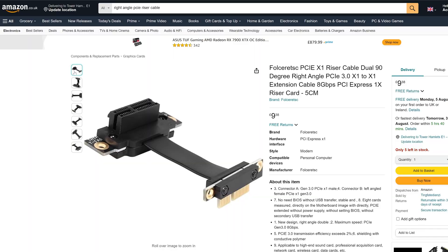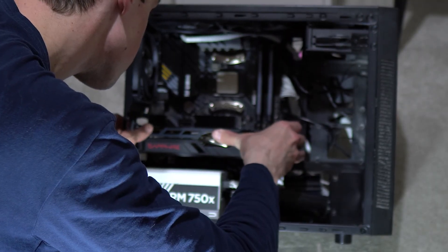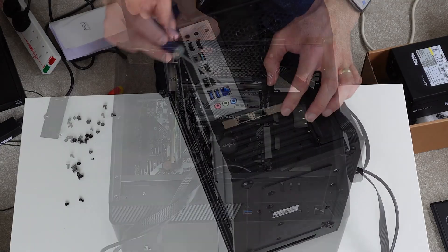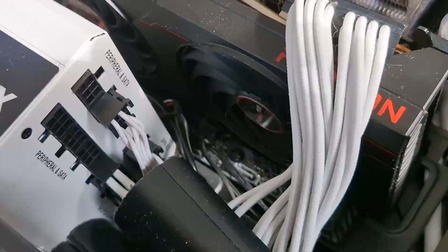If this method doesn't sound right for you, the third thing you could try is — to buy a riser cable. No, I'm not mad, and my teleprompter hasn't crashed. Kidding. Basically, in some cases you can get a slimline riser cable and put it into the covered-up slot before you install your graphics card. This means you can plug your other PCIe device into that cable freely, extending it to another part of your case. Naturally, if the card exposes ports on the back like USB connectors or Ethernet jacks, you have a similar mounting problem. But if it's a PCIe M.2 NVMe adapter, for example, this could work quite well — you just need to make sure your graphics card has sufficient clearance underneath, and that the riser cable is as slimline as possible.